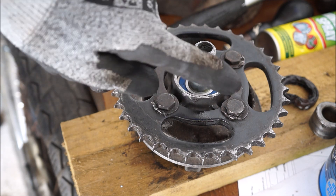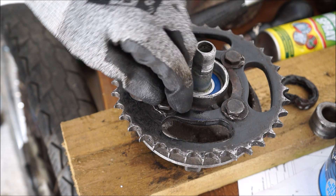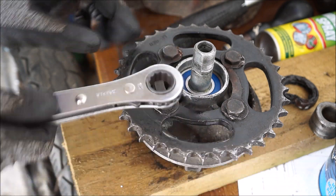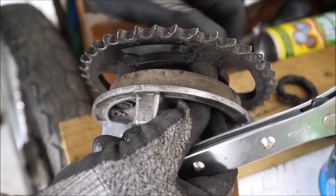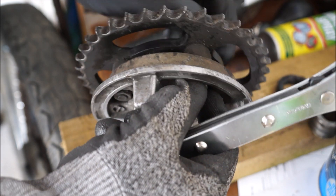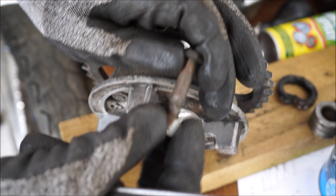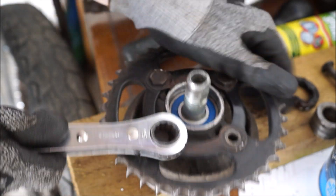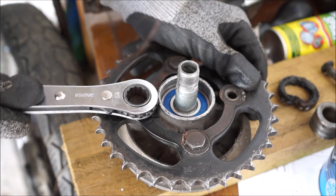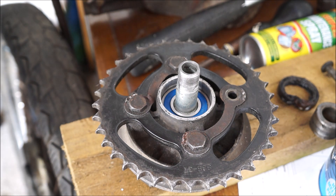I've flattened down these edges and I've just gone to undo that bolt with a 15mm and it just turns — look at that, just turns. Someone's put a nylock underneath, just not having the correct nut, and it's quite rusty. Let's put that back on there. Let's see if the others come off. Oh, that one's not a 15mm. It came loose because it was loose — not always a good sign.